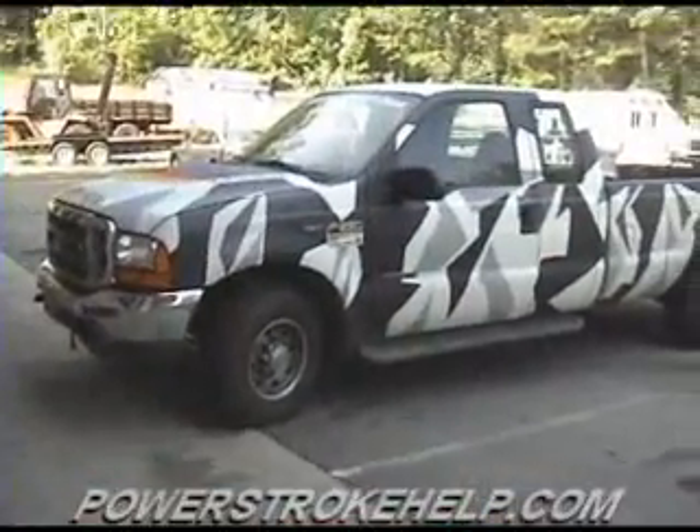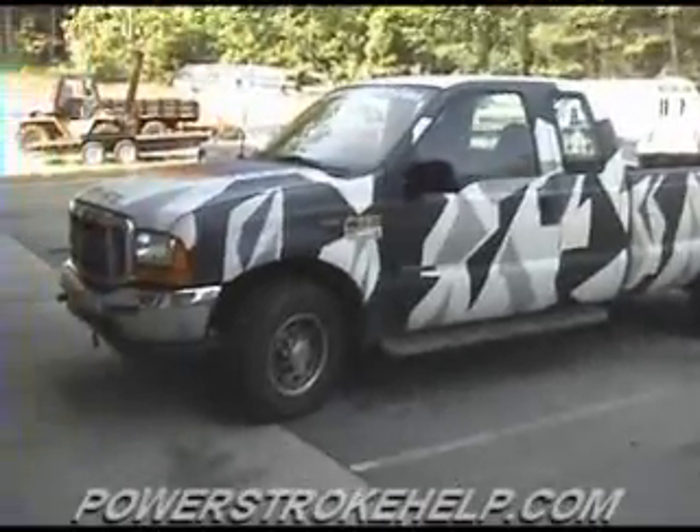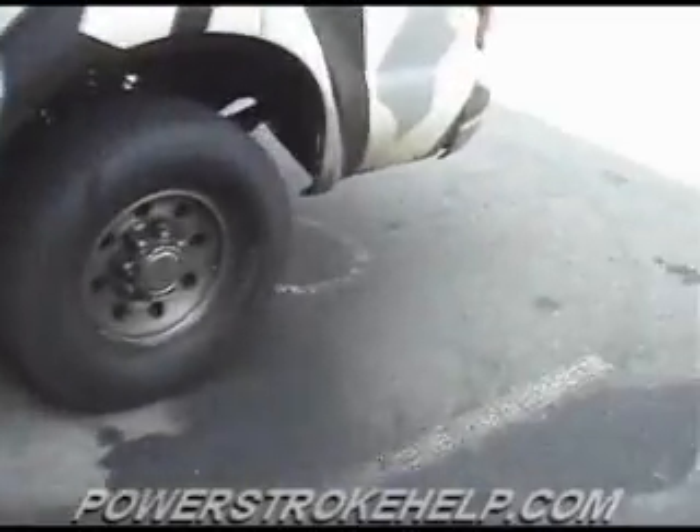That's the one we take as being the accurate representation of the power output for that particular test. Follow along with us — we're going to show you a dyno run and show you how it works. Then I'm going to explain all the different power outputs that correspond to each of the modifications we've made to the truck. The results are really quite amazing. In the moderate power range of the tuner, we've gotten 600 foot-pounds of output with propane and we've increased our fuel economy by almost 30%. The test vehicle is a 2000 F-250 two-wheel drive, extended cab, long bed.